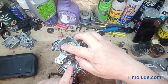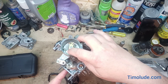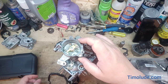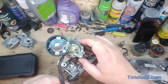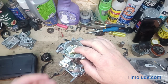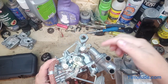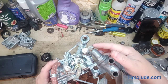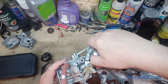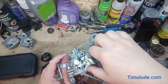As you can see, that's moving this mechanism right here, which moves the choke flaps open and closed. As long as the ignition is on, this is warming up and it acts as a fail-safe to make sure the choke is turned off if all other choke components fail — such as your wax case not pushing down far enough to deactivate your staircase.